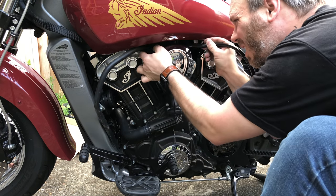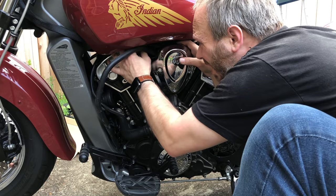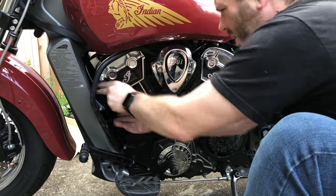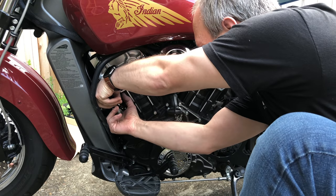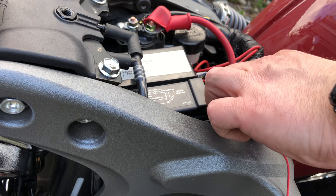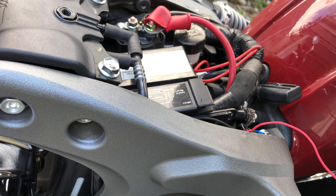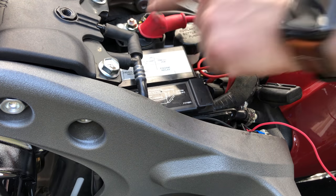A little bit at a time — there we go, we're on the horn. I still need to get this routed back and behind everything. I've got a little spade terminal on these two ground leads — one goes to the guard dog, the other to the horn. There's the ground lug on the bike — tighten that up. This will go to the horn relay I'll toss under here. I do have enough room for a relay right here — just barely. I'll catch some power and fuse it, maybe up there.